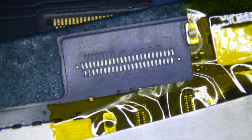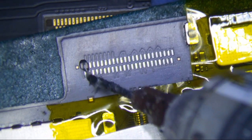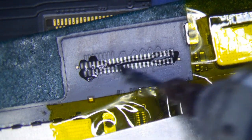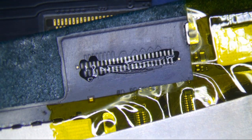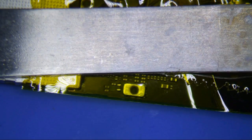Now I have my new charge port here. I'm going to tin the pads — it'll make it adhere a little easier. Essentially, the new connector has a hole in the pad, and solder is able to flow through the hole to connect the pad on the top to the pad on the logic board. That's kind of how it makes a connection.